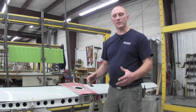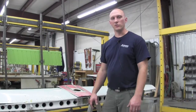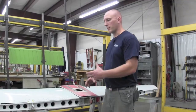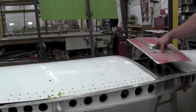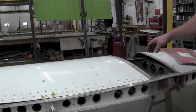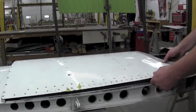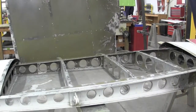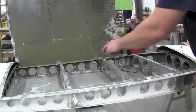It's best to do this off the aircraft since you can't gain access like you need to on the aircraft. To do that, you'll have the horizontal pulled off and sitting on sawhorses. You'll need to remove the center section skin and then remove all the rivets around just the top side of the horizontal stabilizer, then open it up to gain access to the nose ribs.